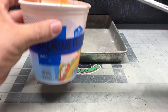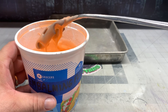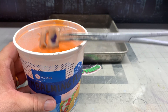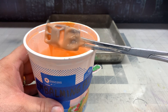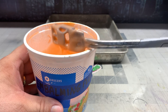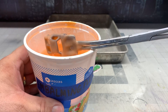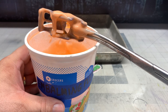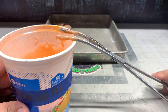So I'm going to dip it in the embalming fluid and put it on this tray and let it sit. I used to leave the body soaking in the Citrus Strip, but I found out that if I left it in there I sometimes forgot it was there for a few days. If you do leave it in the Citrus Strip for a while it is going to start to attack the metal a little bit, so don't leave it in too long. I decided just to dip it and put it on the tray - that way I can see it, and if the paint has bubbled off I tend to get to it a little bit faster.